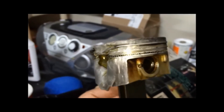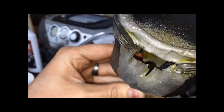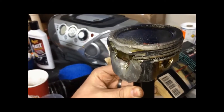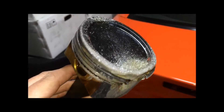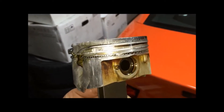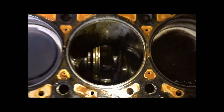This is the kind of damage you can incur — losing the entire engine — basically just because of a lean condition. A lot of people don't understand how an alternator can cause this, but as explained earlier: you lose the alternator, you lose fuel pressure eventually if you're running on battery only. You've got your headlights on, your full fuel system, the radio, all the electrical — so if you don't want this to happen, you need to find a way to measure voltage and make sure you don't melt your engine apart.